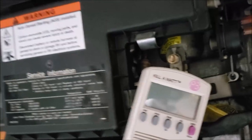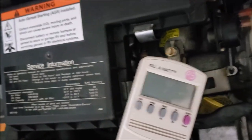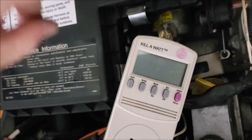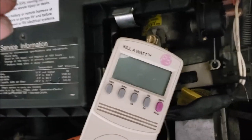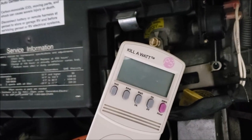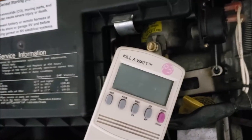So if you've seen what I was doing: I turned the screw in until — you have to wait a minute for it to settle in, don't do it real fast — you'll notice it'll start to surge, the RPMs start to drop, the hertz start to drop. So I backed it up until it got steady and didn't surge anymore, then I gave it one full turn after that. I think that sets us a good mixture. This one doesn't seem to have the effect where you can turn in until RPMs drop and then back out until RPMs drop — but one full turn off of the surging point I think will be a good mixture.